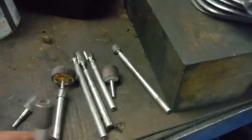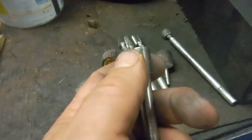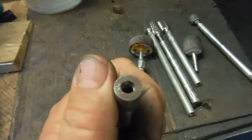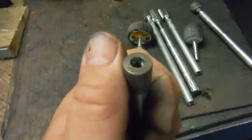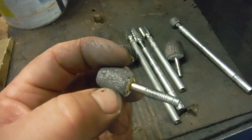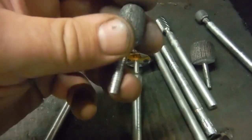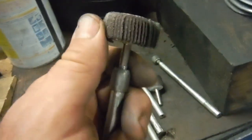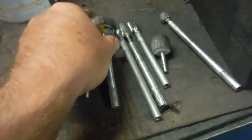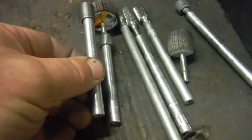These are all British-style Royal Enfield bullet push rods, so they're quarter BSF thread. Later ones were M6 metric — if they're M6, you can just as easily put an M6 tap on the shanks of these flap wheels and cut that thread on them. Either way they'll screw into your push rod and you've got a nice extension. You could even have a longer extension — I've just used them at this length.